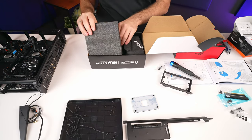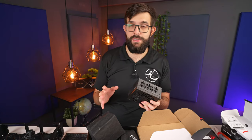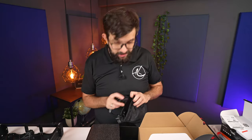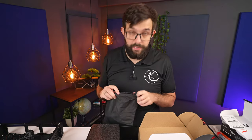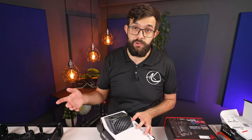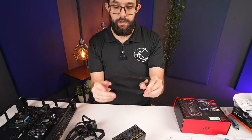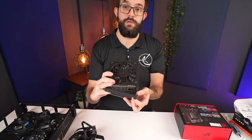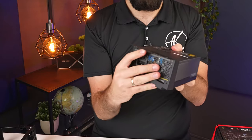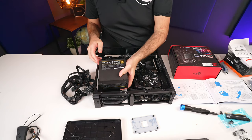We're using a 650W SFX power supply, which is fine for most mid-range systems. Don't expect to run a 4090 on full bore — it'll probably run but at some point you'll trip and lose your game progress. In this build we're not going to use any of the SSDs, but the board supports two NVMe drives so there's plenty of storage potential. For the power supply orientation it's important to plan it out — with this bracket you want the PSU fan unobstructed, pulling in fresh air from outside and pushing it out the back. If you mount it the wrong way there's a shroud behind it and you'll be suffocating the power supply.